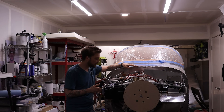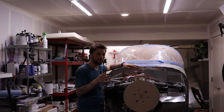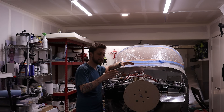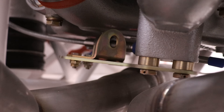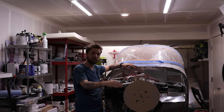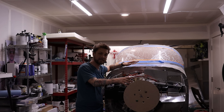Mixture has been a bit of a problem. The hole is there and I think it's going to work, but unfortunately the cable is not. I have a 50.5-inch cable, which would be typical for this install, except my motor is not typical. It might have even worked except earlier I decided to rotate my fuel servo to have more advantageous runs on most lines — the exception apparently being the mixture cable. Even though it's a really straight shot, the geometry means I actually need more of a 54-inch cable, which just so happens to be out of stock at Van's until August. I ordered a custom one from Spruce, then found out it had a six-week lead time, so I cancelled that order. I'm back to square one — no mixture cable but wanting desperately to get this part done.